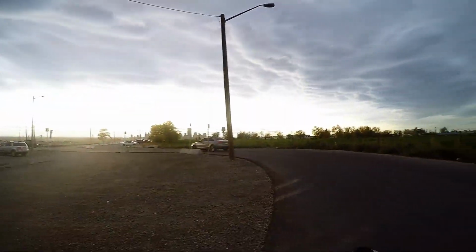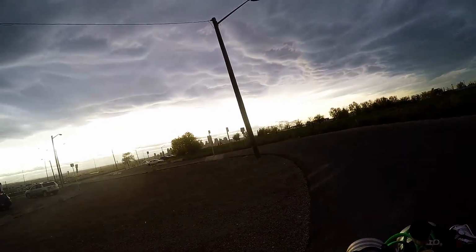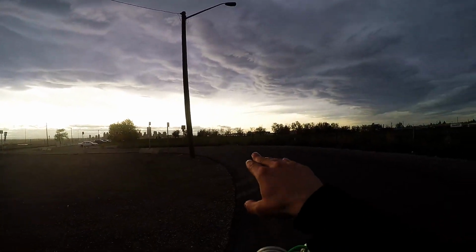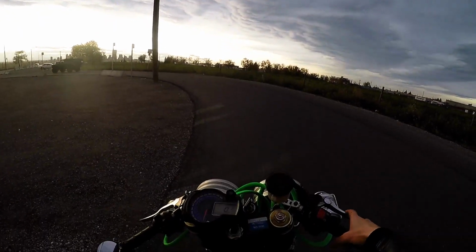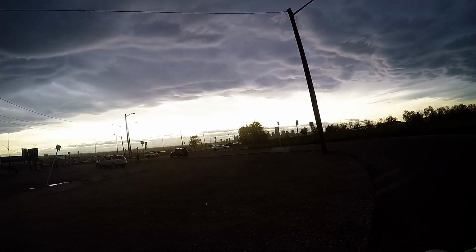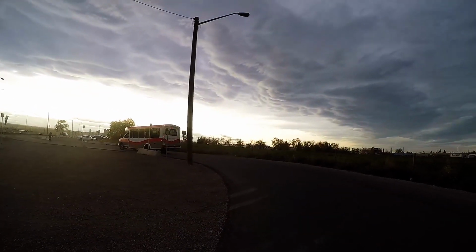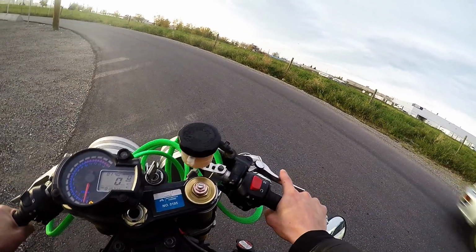So for me, I guess it's somewhere in here. At this point, I've entered through most of the corner, slowing down the whole way, trailing my brakes in, and if I didn't carry enough corner speed, I'm still just touching the brake a little until I get to the point. Actually, my apex will be ahead of me here, but anyways. And then, at that point, when you're off the throttle, off the brake, and not on the throttle, that's when you're dead sailing, and that's actually when your bike is at the most unstable, because all of the inputs on it right now are the road and the momentum. There's no rider input. I guess the handlebars still, right? You're still cornering on the apex.